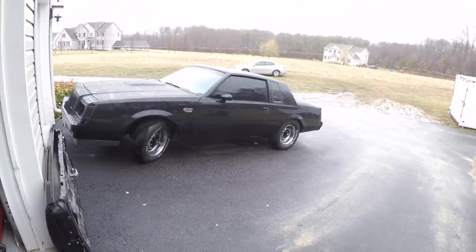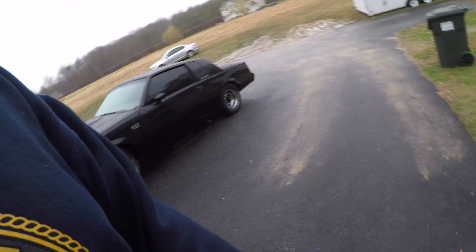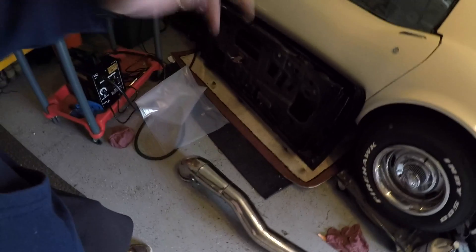It's the next day, still raining, weather still looking bad, but I'm gonna continue doing the downpipe. Like I mentioned earlier, I'm gonna put it in right now and mark the spots that I need to dent - here and here - just to make sure it doesn't touch the frame when the engine torques to the side whenever you get on it. I'm also gonna be taking it back to Anderson Performance to get the speed sensor installed on the driveshaft. Once that's done it should allow me to activate the traction control feature on the XFI box.